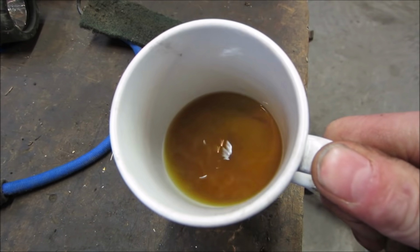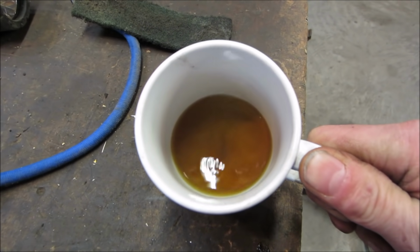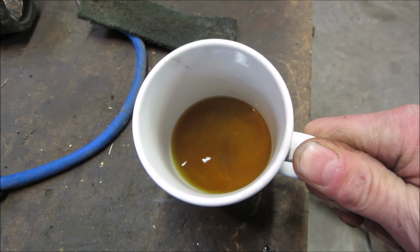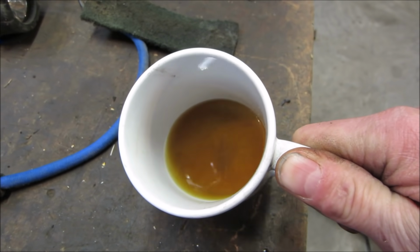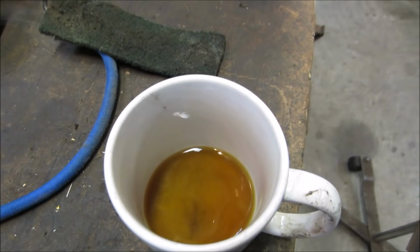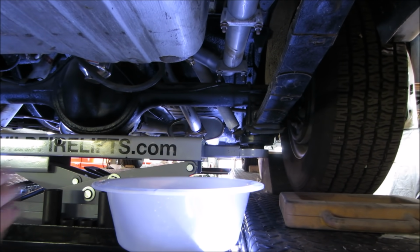I'm gonna go try purging for a little while. Actually, it looks like it's even got water in it. I'm gonna try purging it a little bit, see if we get it to go clear. If not, I'm gonna drain whatever's in there. We'll try to get some fresh stuff. I don't wanna contaminate the carburetor if it's not already happened to it. Yeah, we'll let some of that pee for a little bit, see what we get.